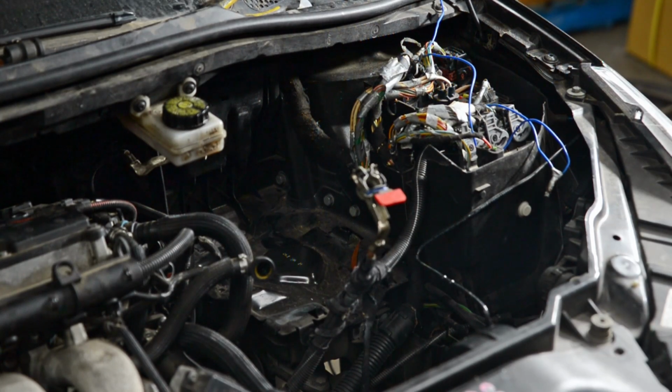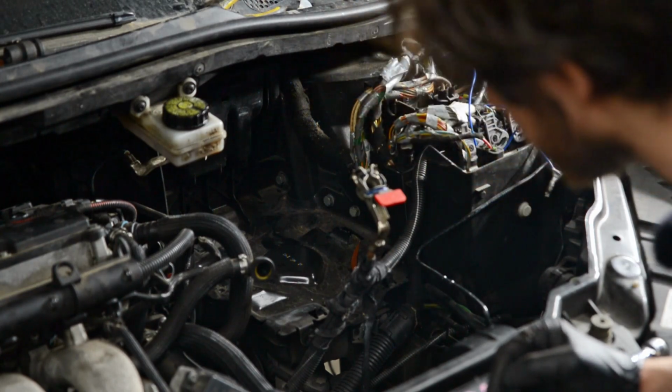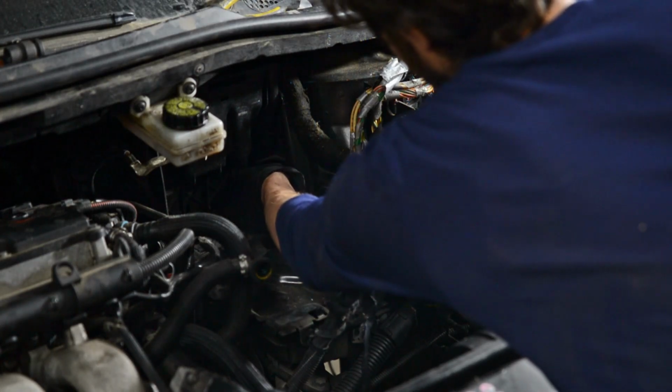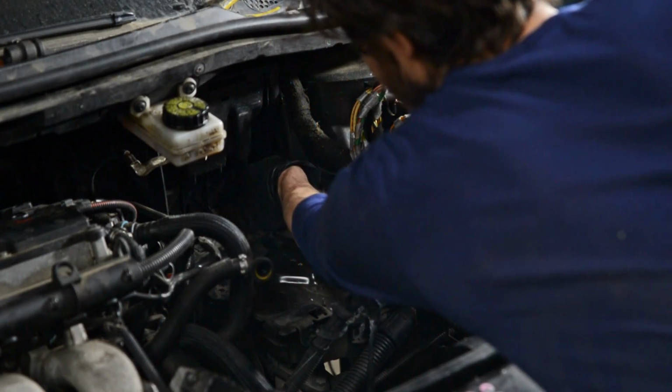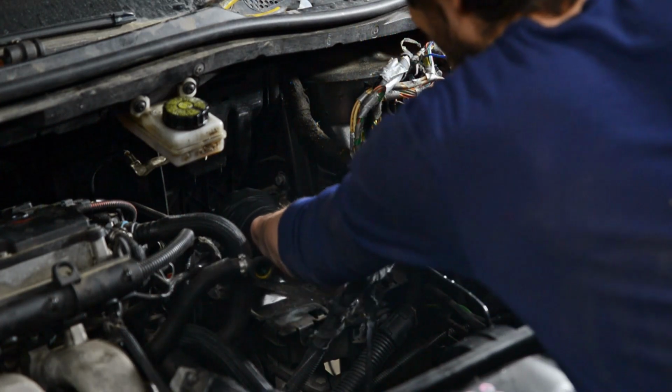In order to have access to the top gearbox mount, and all the shifter linkages and all that kind of thing, you have to remove the battery tray. Two of the four screws holding on the battery tray were loose. So that's fun.